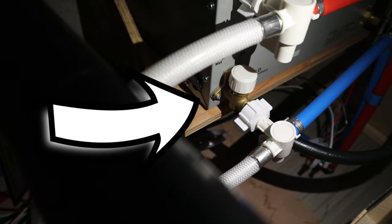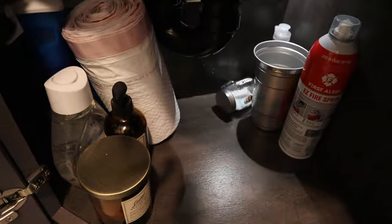For two weeks we ran off the internal water tank using the pump because the hot water wouldn't work — especially for the shower. What we found was underneath the sink, where the hot water tank is, there's a knob down there. That knob appears to be some sort of regulator that was affecting the internal pressure and preventing the hot water from kicking on. Make sure that is fully open and you should be good to go.